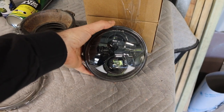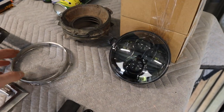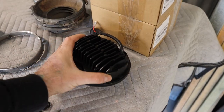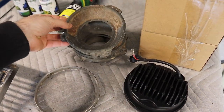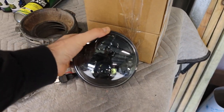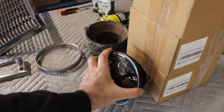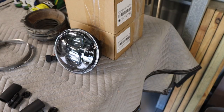For the high and low beams I've ordered a set of LEDs off eBay. They're the same diameter as your standard H series headlights so the surrounds fit over no worries, but the only problem is they're a little bulkier on the back end because of the heat sink. So I'm going to have to modify the buckets where they sit to get these to fit in, but I think they'll turn out pretty good — a hell of a lot brighter than standard lights. I'll put a link in the show notes for the eBay store.